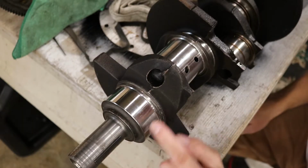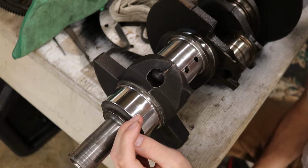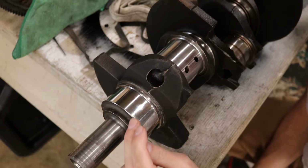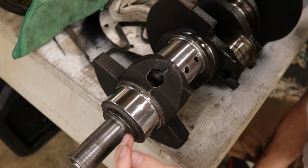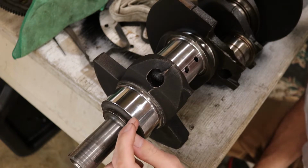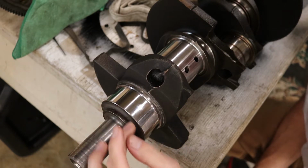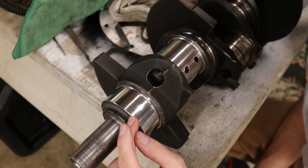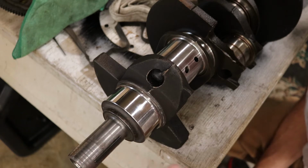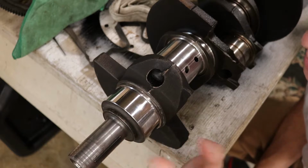So what happens, from what I would assume, is that if you have an impact mark and a raised area around it, as it's sweeping by the bearing, it's taking the layer of oil off, and back here there's now a thinner layer of oil for this to ride on. If this is big enough, this could actually make contact, wiping all the oil away, which then will make more contact back here. Even though this is continuously oiling, it's got an oiling hole, it's still just really bad. You really don't want that.